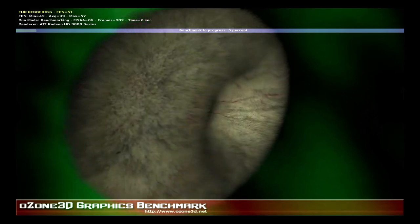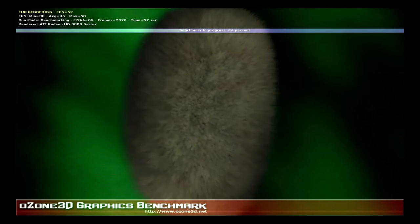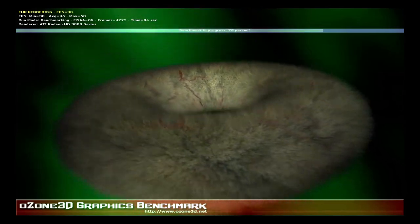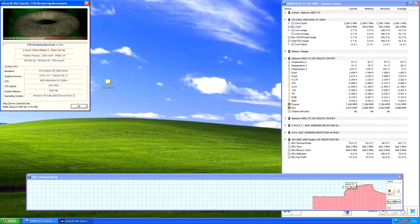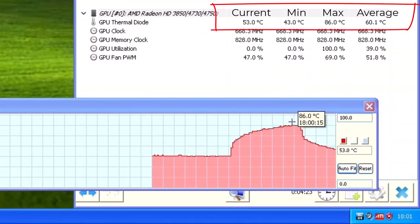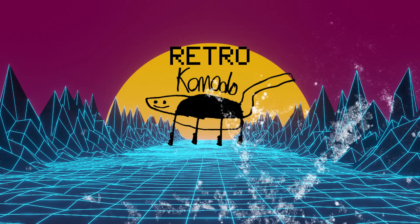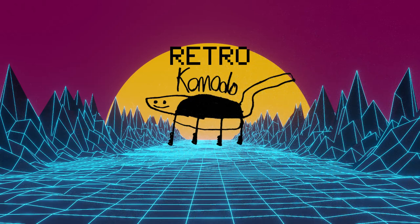You're probably wondering what the stock cooler temperature gets to. Here is the second 3850 with the stock cooler; running at idle in an open-sided case it sits at 44 degrees. After running FurMark for 2 minutes I could hear the fan speeding up even faster, and then when it finished I got a bit of a shock. The stock 3850 had doubled its temperature from a recorded start of 43 degrees to a peak of 86. The card with the replacement fan, however, went from a chilly 40 degrees at both fan settings to 63 or 65 depending on the fan voltage. In conclusion, if you get an AGP 3850, I suggest you look into replacing the cooler. I'm going to find more coolers to test, and at some point I'll get that thermal adhesive off those ram sinks and stick them on with thermal pads, but for now it seems just fine with airflow cooling the memory.